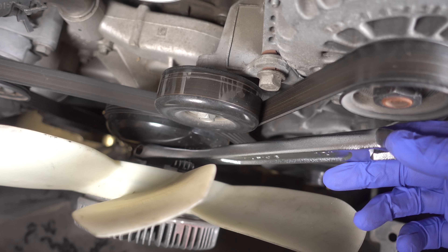Taking a closer look here, you can see the inside of the pulley. This is the bolt and there is the pulley. Because I used the right tool for the job, it came off without any issues at all. The reason I had to remove that power steering pulley first is because there are three bolts located directly behind it — there's no way to access these bolts unless you remove that pulley. These three bolts attach this power steering pump to this bracket.